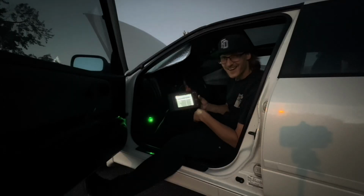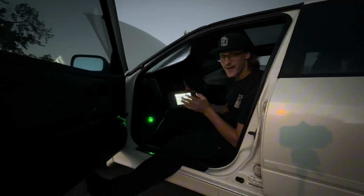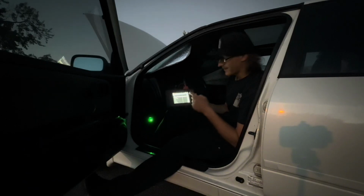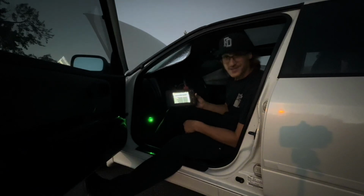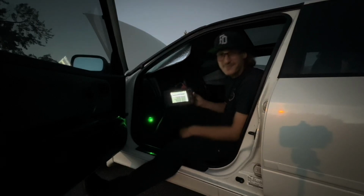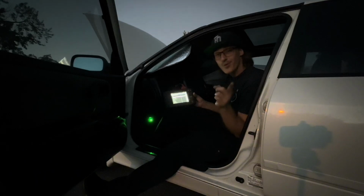Yeah, that's not ideal. So since it's not reading at all, we can double check those wires, make sure the wires aren't bad. The wires are looking okay, which we kind of already scanned over them. We might need to swap out our mass airflow sensor. Thumbs down, gonna have to spend money, but we'll grab a new mass airflow sensor and I'll catch you when we are throwing it in.